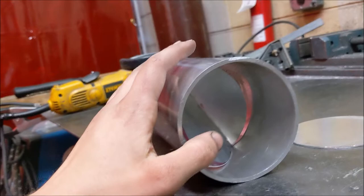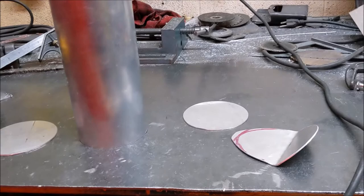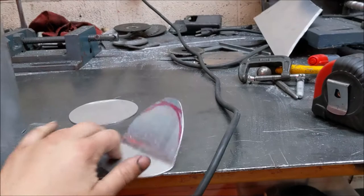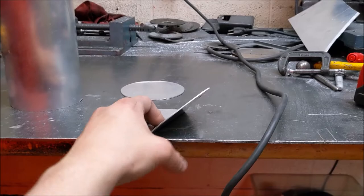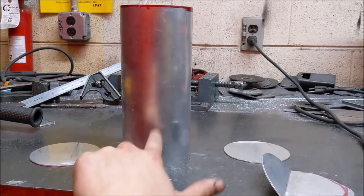It'll sit relatively like that. It'll hold steel wool up there and I'll drill a bunch of holes in that little plate. This plate is going to have a bunch of holes drilled in it — that's what I'm going to do next. Then one of the end caps will have a hole for a breather. I'll have two dash-10 AN lines going into it, going in directly behind the flap, with air pushed down, and then up through the breather.